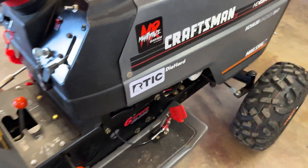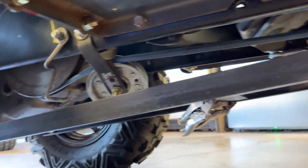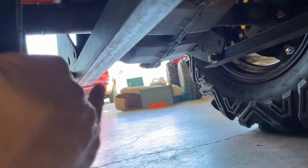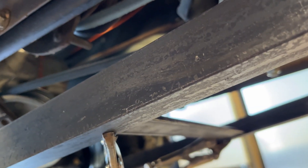First off, I've already started some of this. Right now I am working on building a skid plate for under the Marshall. It's going to have two bolts up front and in the back. I'm going to use the actual bottom hole on each side of the hitch plate — so stock holes there — two new holes here. I'm getting ready to weld this cross brace and that pretty much will make this pretty solid.